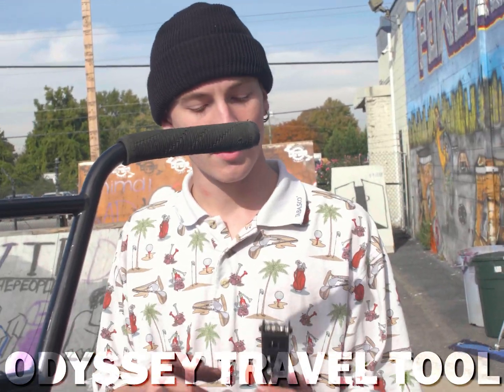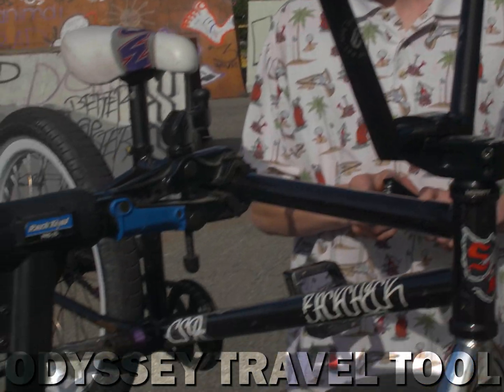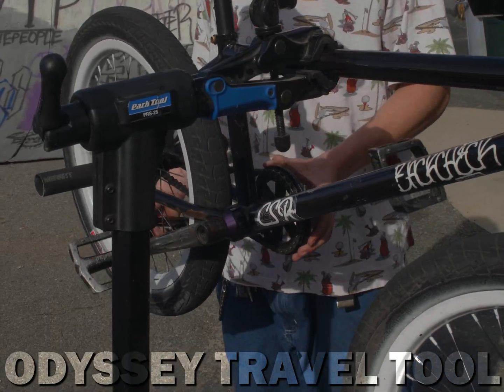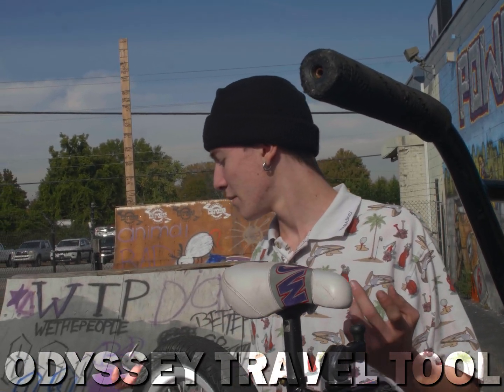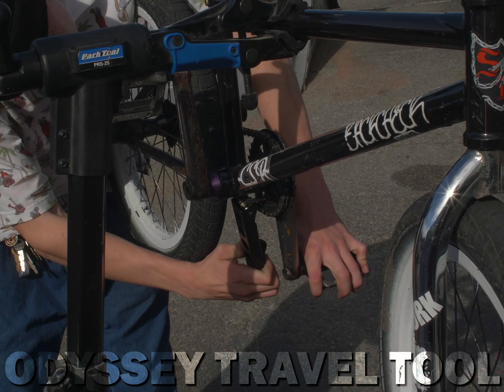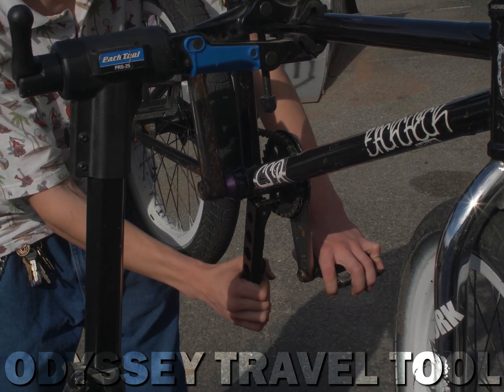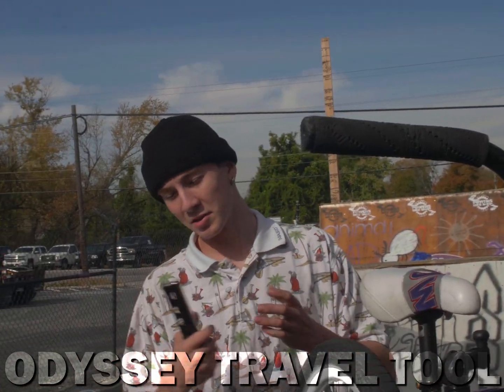While we're here, might as well see if my sprocket's tight. My sprocket is a 6 mil, but if you have an older profile, as I've been informed, you could have a 5.5. In that case, we would be fucked. Looks like I'm able to reach my bolt just fine. Crank it down, seems like it's all right, nice and tight. Cool, Odyssey gets a pass on the drivetrain.